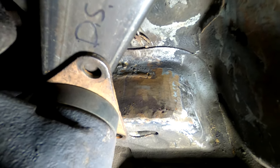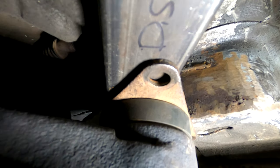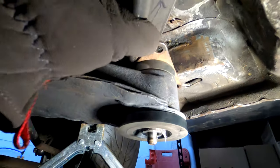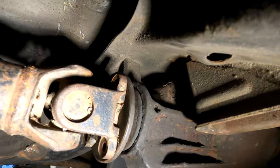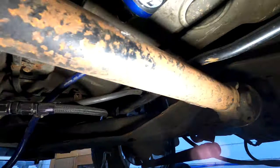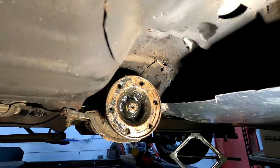So I think two studs, two nuts, and then one bolt on the back is what we're going to do — there's no way to get a nut in there and weld it. Other than that everything fits great. I've got the stub here just for fitment and angle — the drive shaft angle looks fine just like it did originally. You're limited by this — you can't really make it any different angle up or down, wherever your drive shaft is situated is what you have to base it off of.